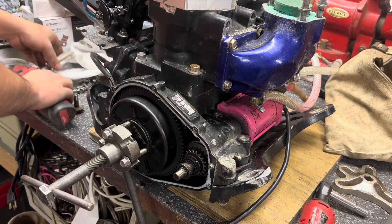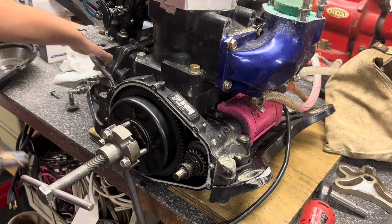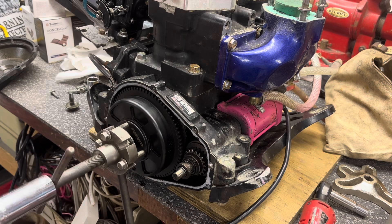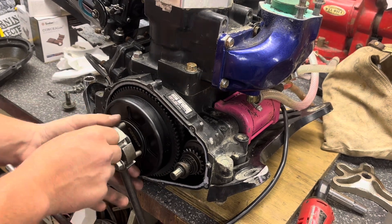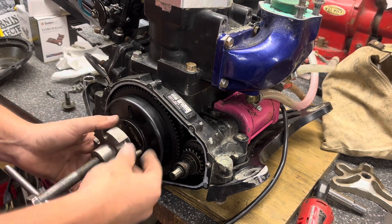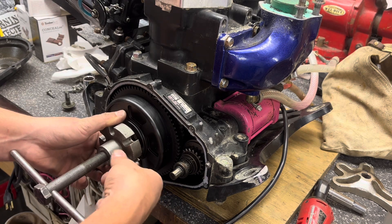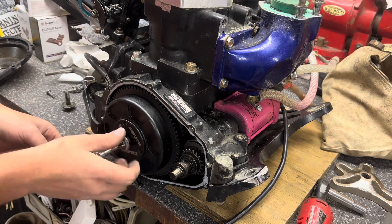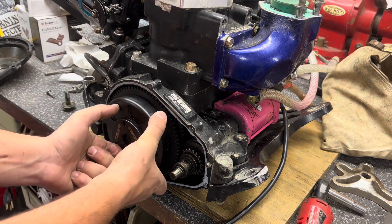I always just rock it so I can tell if one should be backed out. The stock bolt on this one was a 17 millimeter. Switch over to your different socket and keep your hands clear because this will hurt if it hits you. Mine already popped. Sometimes it's stubborn — if it is, put tension on it with your impact and then take a hammer and hit on the end of it; the vibration could set it free. Once you've got that off, take your original bolt and carefully remove it all the way out.